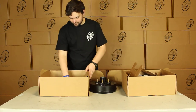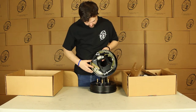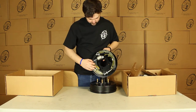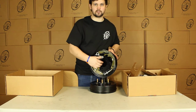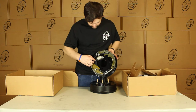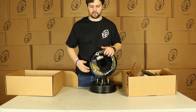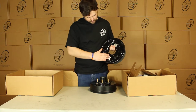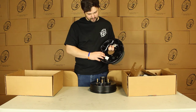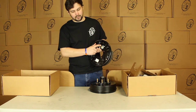Then we have your brake back right here. Your hydraulic cylinder is already in there — everything is ready to go. The studs are not in here; the studs will come separate in our smaller parts. Right here you can see this pin. To know left hand from right hand, this pin has to be facing the tow vehicle. So this will be a left hand, just like that. It's got our TruRide sticker on the back that will also show left hand, right hand, and our hydraulic connections right here.